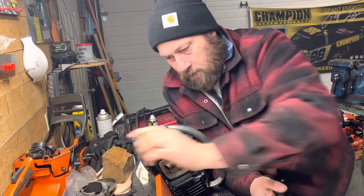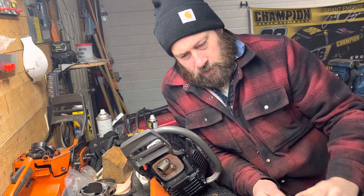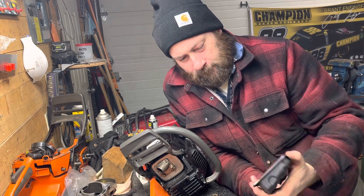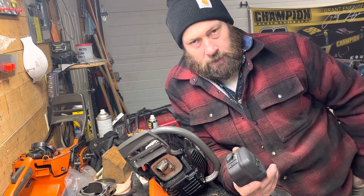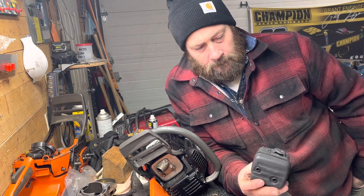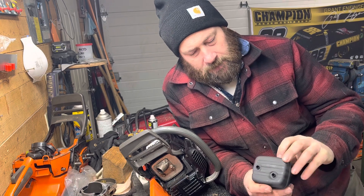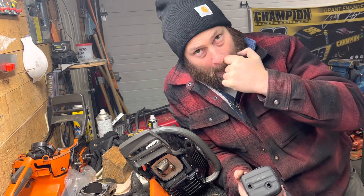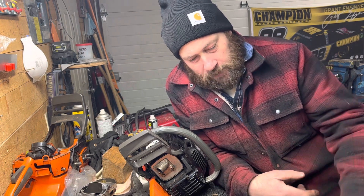There's a little bit of science there, but there are a lot of guys who try to talk about back pressure. You'll notice when you start looking at the mufflers that come stock on your saws, often there's a lot more focus on noise versus performance. If you want something optimized for power, there's going to be less consideration given to noise — you can expect your saw is going to run louder in order to improve the power that it makes.